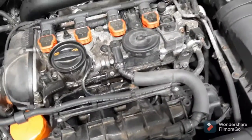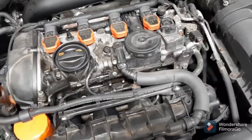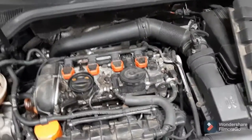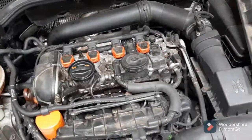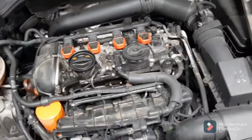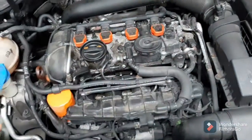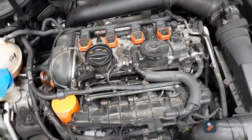When the diaphragm tears, it loads full intake vacuum into your crankcase and damages your rear main seal. The rear main seal is a bad design, but this is actually what causes it to be sucked off the plate in the back of the engine and actually fail completely.